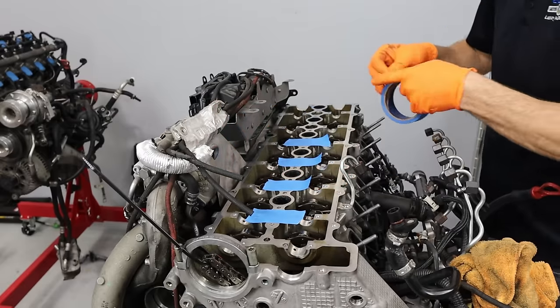Joey helps me get the transmission installed and now we're ready. Before Romeo closes the shop, he gives us a hand pushing the car in. We're feeling pretty good about getting this wrapped up tonight. The Orlando BMW Invasion starts tomorrow at 10 a.m. and if everything goes well, we'll be driving this car there. The cooling system is first put into a vacuum — you can see the coolant hose collapsing as we pull all the air out. We let it stay in vacuum for a while to make sure we don't have any leaks, then the air we removed is replaced with coolant. This system requires a 50-50 mix of coolant and distilled water. I buy my distilled water from Target — it's only about $0.88 a gallon. I stop the process when the gauge reaches about 5 inches of vacuum so I don't overfill it.